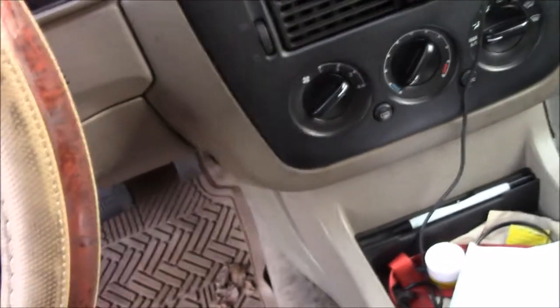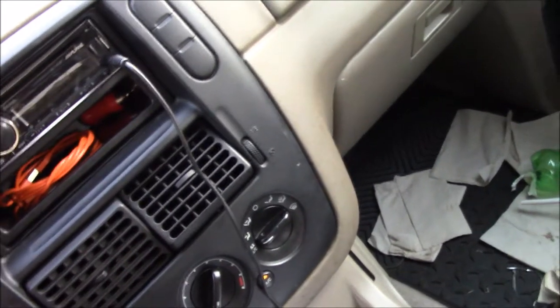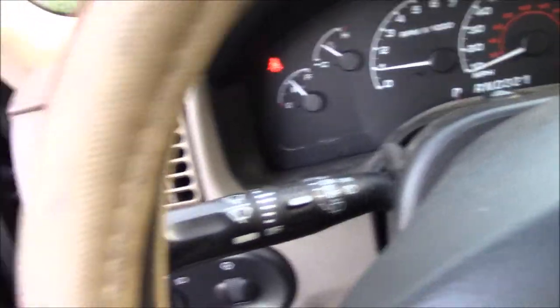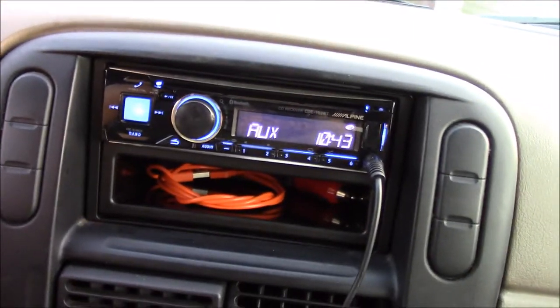It's not going to come on anyway because I forgot to turn the key. Now you can see the door ajar light is on. Now I close the back door - bam, it goes off. It shouldn't go off though because the door's open. I wiggle it back and forth and nothing happens. I turn off my car and my radio doesn't go off. But once again, if I open the door, the radio is now off.